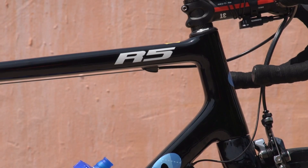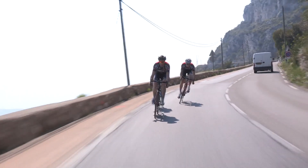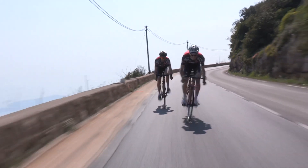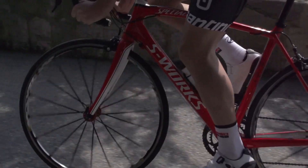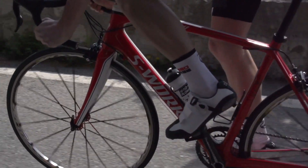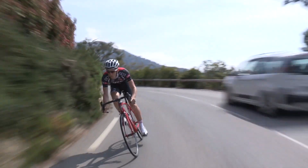For instance, the area behind the head tube — you want that to be really strong and actually a little bit flexible, so if you hit a bollard or a curb, it absorbs the impact and doesn't crack the frame. At the same time, you want your bottom bracket to be really stiff so it doesn't flex back and forth, so anything you push on the pedal goes into propelling the bike ahead. In some areas you need high strength, and sometimes you want high stiffness for descending so the bike tracks really nicely and you get lots of power transmission.